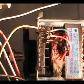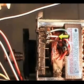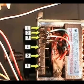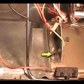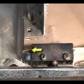Well, we have almost all the wires disconnected from the motor switch. Whatever you do, do not disconnect any wires coming from inside of the motor to the motor switch. Okay? This is the way I label the terminals on the motor switch according to how many wires. Remove the screw from the motor bracket and remove the brown wire from the idler spring switch.